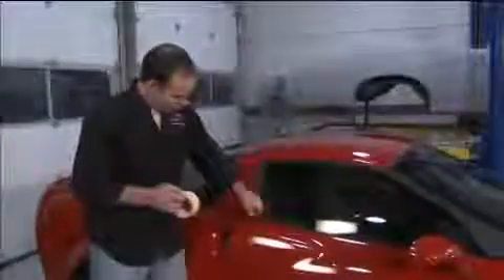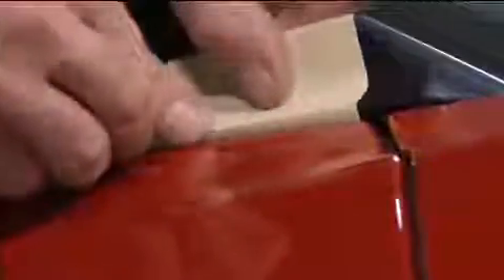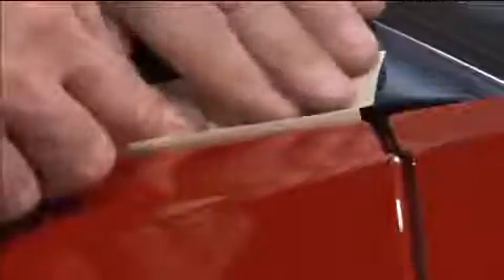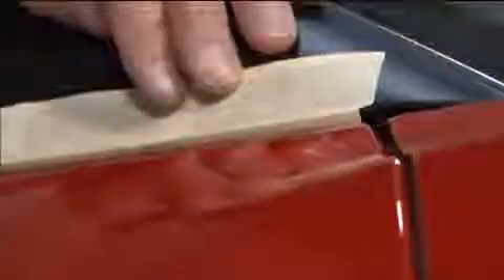The windshields are flush-mounted, and the side rubbers here extend well into the panel. Best practices has a way of masking a car properly, and it involves some premium trim tape. This tape has about three-quarters of an inch of mylar, which slides underneath the rubber and doesn't catch. It allows you to lift the rubber up and out of the way, and the sticky portion can be stuck down to either the glass or the bodywork itself — a nice way to get paint right underneath the rubber.